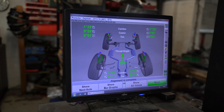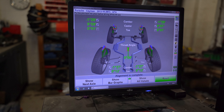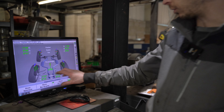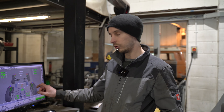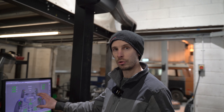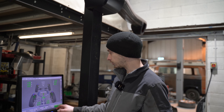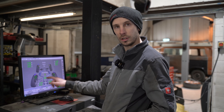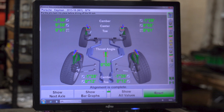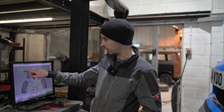The rear is totally symmetrical — did we just get lucky? We always pride ourselves on being able to get all values, where possible, to within two minutes. Symmetry is king — it wouldn't matter if the whole page was red, as long as the car is symmetrical it would at least drive in a straight line. The shims don't show up in these readings per se — you'd notice the difference if we look at the previous caster values.